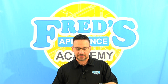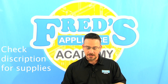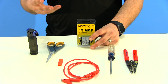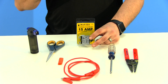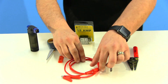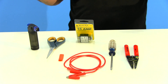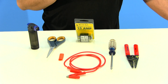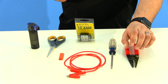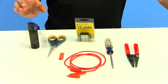All the items we're going to use for this breaker are in the description — it's all from Amazon. The first thing you'll need is a 15 amp resettable fuse breaker. If something trips, you don't replace it — just disconnect it from the circuit and reset the breaker. You'll also need alligator wire with clips on both ends to prevent shorting to the cabinet, a piece of heat shrink, wire strippers, a Phillips head screwdriver, scissors, and a heat source — I'm using a butane mini torch.